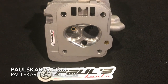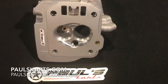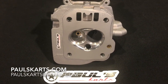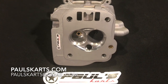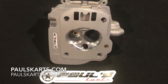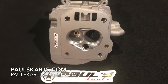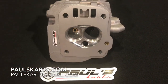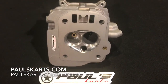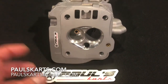If you put this cylinder head on a stock bore stock stroke, it's not that it won't work - it's just that you could lose some fuel signal due to the drop in velocity for the gain in CFM. It's just like with a camshaft where you sacrifice some bottom end to put the power up top. It's the same with a cylinder head: when you increase CFM you drop velocity.